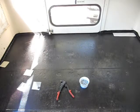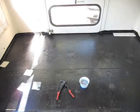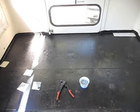I'll come back after I get these little things riveted down. I'm just going to put some little, looks like 3/16 rivets. Put a bunch in each patch. That should be good. I'm going to come back and put some of that enamel over the top and let it seep down around the cracks, and then spray the rubberize from underneath. The reason I couldn't weld these spots is because they really put some super thick rubberize underneath, and you can't weld to it from the top, because it'll just keep catching on fire, and it just puts off a vapor that keeps you from welding.